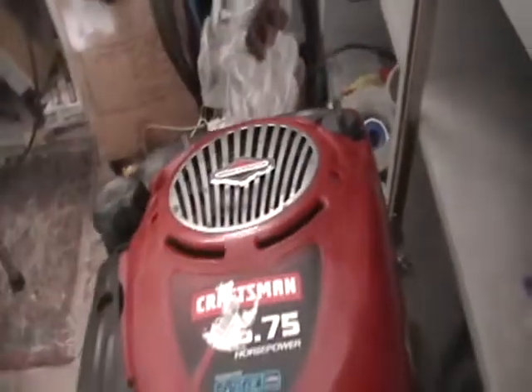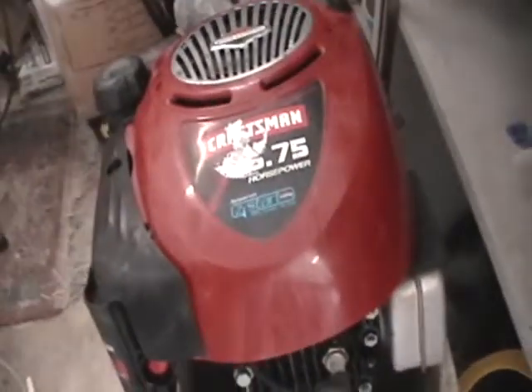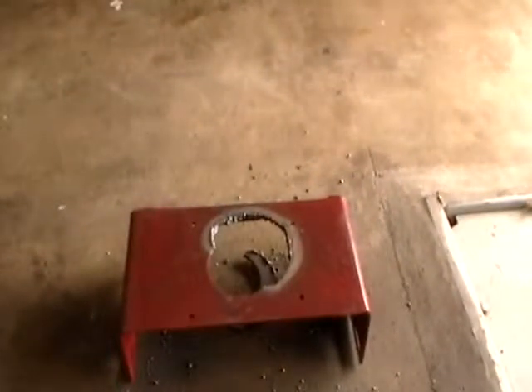Something I'm going to have to do with the motor is — you know how on a pull lawn mower you have to pull the grip and there's an internal brake in here? What that does is it pulls on this, and there's kind of like a little drum brake inside there and it also kills the ignition. So I think what I'll wind up doing is take out that drum brake part and just wire a kill switch up by the tongue of the trailer. Alright, so that's where we're at so far, I'll get back with y'all later.